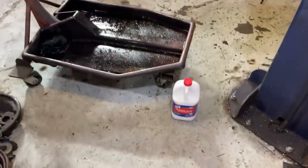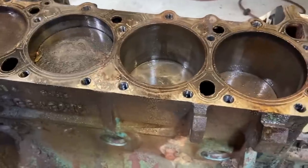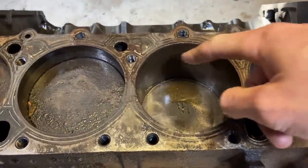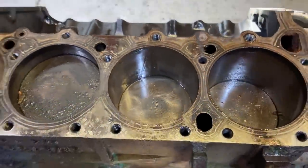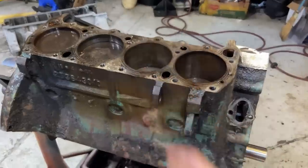All right, I've returned with the acid, so the plan is just going to be brake clean out the cylinders, this way all the Marvel is out of there, and it's clean, bare metal, so we can let that muriatic acid just eat away at the top of the piston and the rings, and hopefully break her free. And we'll give it a few hours to marinate like that and cross our fingers that is what works.